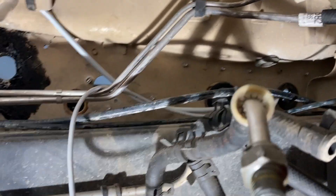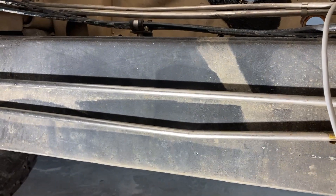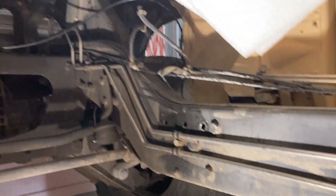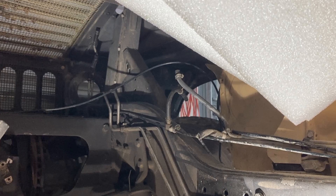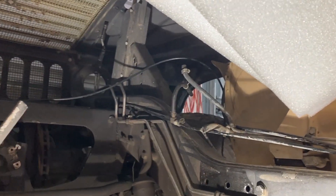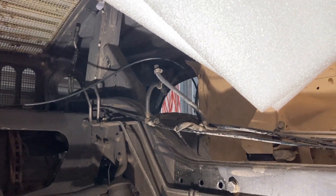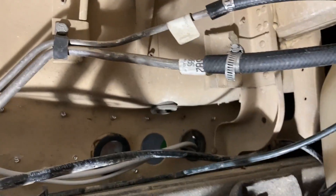The last part is connecting the fuel lines — it looks like it's these two because they pop out and you can see them wiggling there, and that's about where the mechanical pump on the diesel engine would have been. The other option was these — they're equal in size and they're probably a transmission cooler, because up near the hood vent is where those lines come out. It makes sense because they're back about where the transmission would be and they're threaded like they would thread into a transmission.